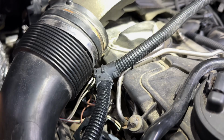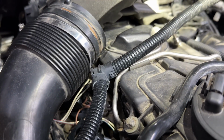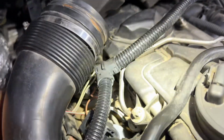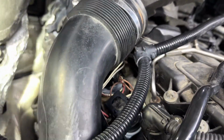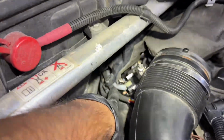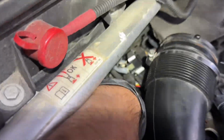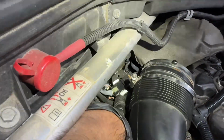I wish I could show you guys where the clip is at. Oh, right here. Is this it? Yep. Let me run them on the clip and I'll show you guys. Oh, I can't really see it. But that's the harness for the oxygen sensor. Those are the two connectors. Just like we talked about earlier, white housing to the white housing, black housing to the black housing.